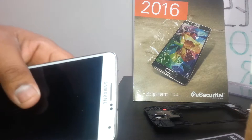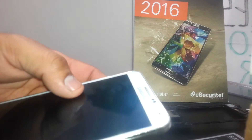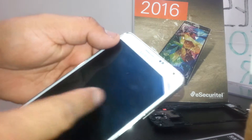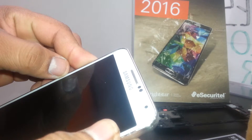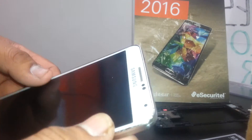If it's hard to slide, heat it a little more until you're able to open it. Using a longer plastic tool, insert it and work through this area since there's glue under the touchscreen digitizer. You can also use a larger SIM card — the regular full-size SIM card — and slide it along with the heat applied. That's the way to remove the touchscreen digitizer.